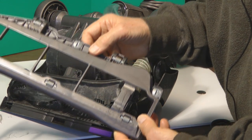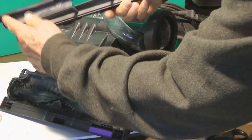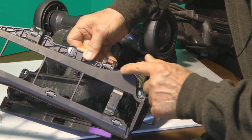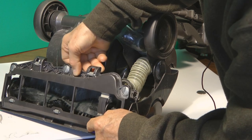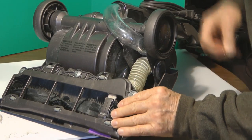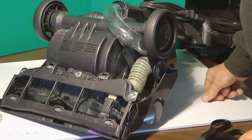When you put it back together again, make sure the rubber gasket is in place like that and then reattach it. It's worth noting that it has little holes right here that the pins go into — you slide the pins into the holes. Then make sure the screw heads are oriented up and down like this, then slide this into the slots. Push it down and it goes right back in. Then turn these a quarter turn clockwise to lock it back into shape.